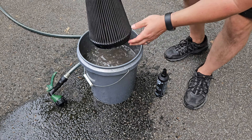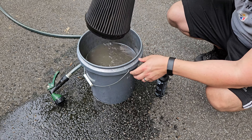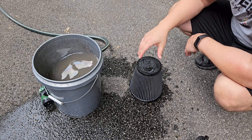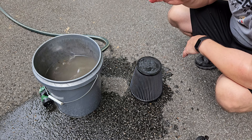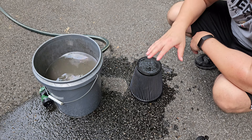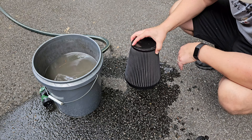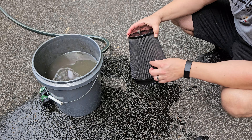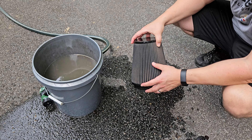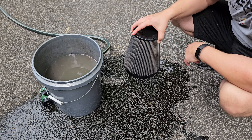Once that water is clear, we're going to let it air dry. This is the part some folks may try to rush, and you don't want to do that. Do not use any kind of compressed air or anything like that. What we really want to do is find a space to air dry outside for probably 12 to 24 hours. I know you're saying you need it clean in two hours, but you can't accelerate this process. Plan ahead — it's going to take about a day to do this right, because we are not going to re-oil this filter until it is 100% dry. Don't try to accelerate that with an air blower — you can damage the pleats. These can get bent, so be very careful. Leave this outside and pick it back up after it's had ample time to dry.